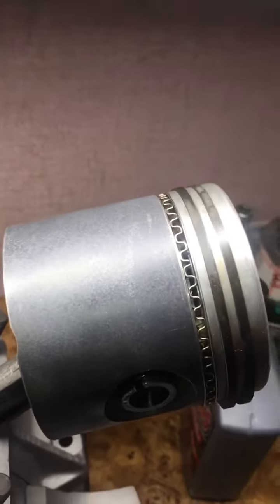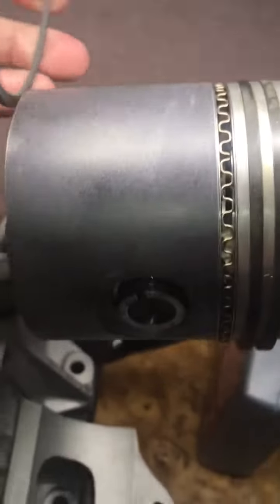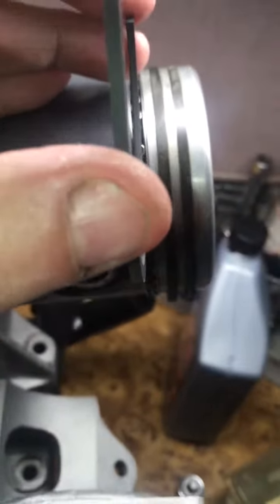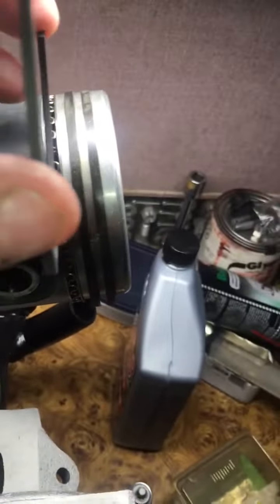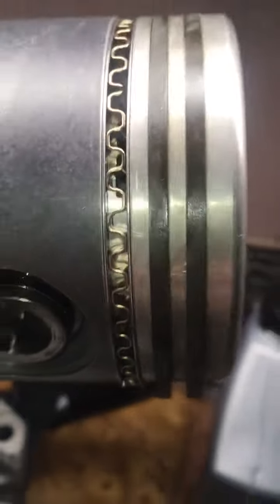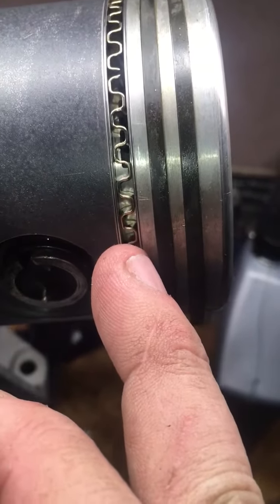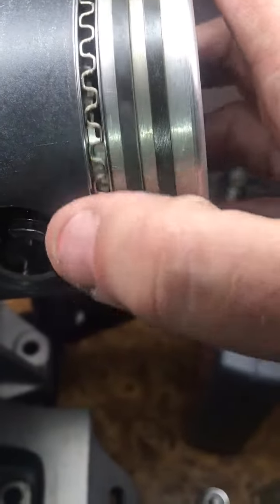Second of all, I had mentioned that flatheads always used 3 compression rings and no oil control ring, and I had to change that. As you can see, the oil control ring is much thicker than the standard compression rings, so I had to have the machine shop enlarge the size of this groove to fit the 3-piece oil control ring.